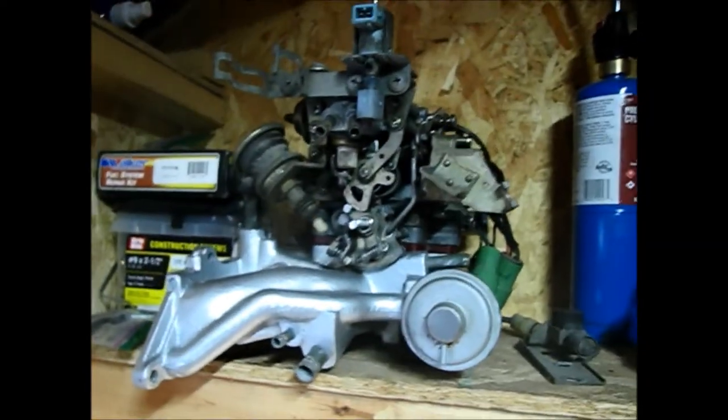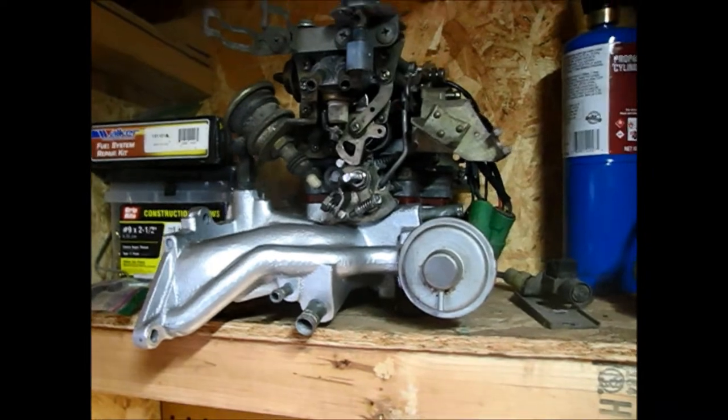I have my carburetor and intake manifold sitting up here waiting to be installed. But today I'm going to be doing some very mild work on my exhaust manifold. If you've seen one of my previous videos from way back when I originally took it off, about two months ago, I noticed that there were two cracks in the exhaust manifold. Nothing major, just something that I want to take care of. I want to grind a groove in it and prep it for welding - just put a bead right over the cracks and that should hold up enough for me to run it properly.